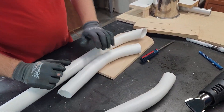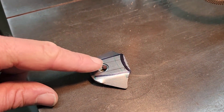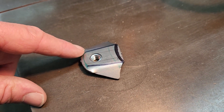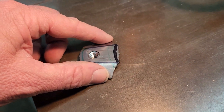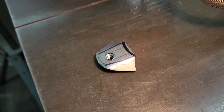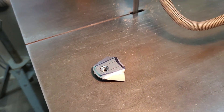I bought these little pre-made tabs at the metal supply store — they already have a nut on them. We're going to cut off the little wings and cut these down to where they'll work for us. We've already got a little radius on there. We're going to cut these on the bandsaw, smooth them out, and get these working for our spring mounts and shock mounts.